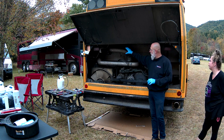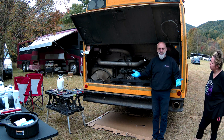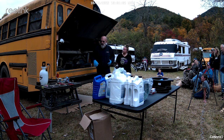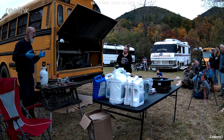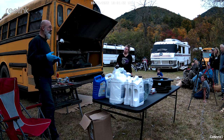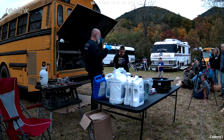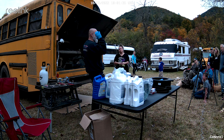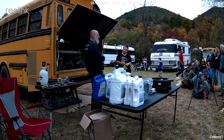The other thing, so we'll be doing the air filter as well, and we'll be showing you how to inspect an air filter just to make sure. It doesn't need to be replaced every time, but you should know how to inspect it. Especially with a rear engine bus, it's gathering all its air from fins on the side of the bus here. So if you're driving down a dirt road, your tires are kicking up a lot of dust, it's sucking in that dust. There's a busing company that Sylvie and I know that they run buses to oil fields, and they actually have a big duct on the top of the bus running the full length of the bus to grab the air at the front of the bus, because they would go through filters daily if they didn't.